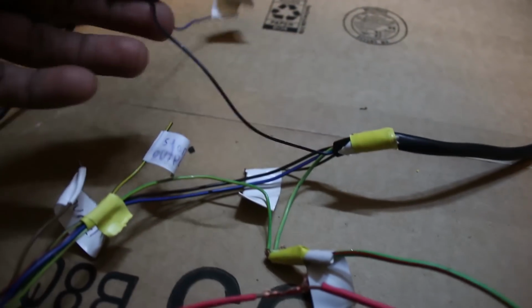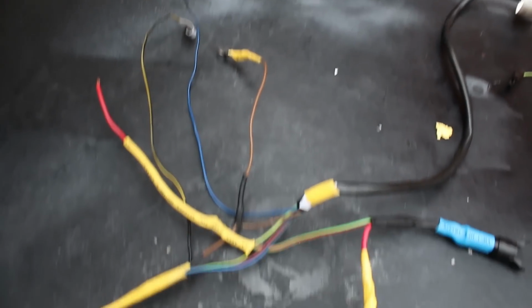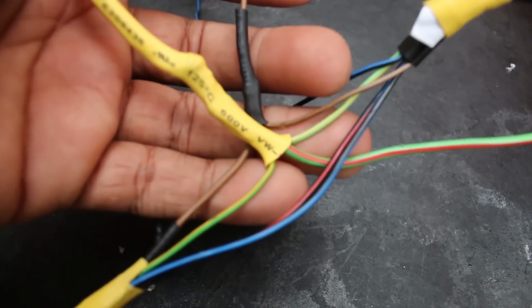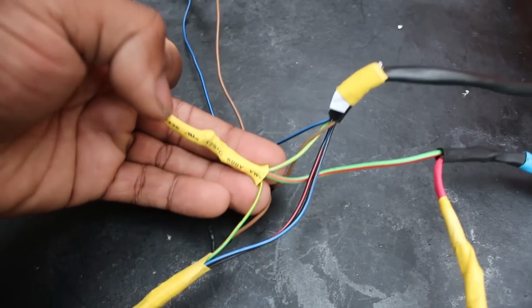After some serious mileage on my thinking cap, I loomed up the ignition harness like so. This is my junction for the 3 wires that go into the M unit ignition output, minus the wire for the fuel pump and the gas tank, because remember, the plan was to wire that separately into the auxiliary output.